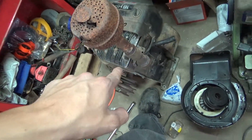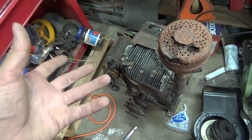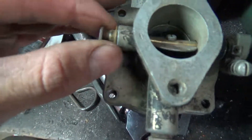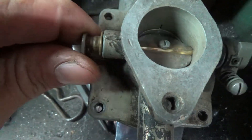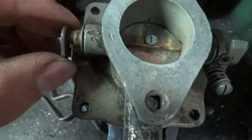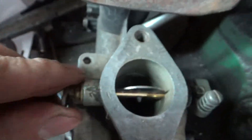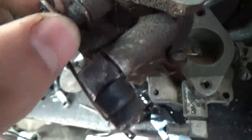This engine has a bad carburetor on it. Other than that, it does run — last time I knew it does run. The carburetor sits up here, and you can see how much play is in this carburetor. I don't know if that's going to affect anything because when it's open it's got all that play, and you can move it up and down. It needs a new rebuild. Up here I have another eight horse updraft carb and she's got a little play, but not as much as this one.